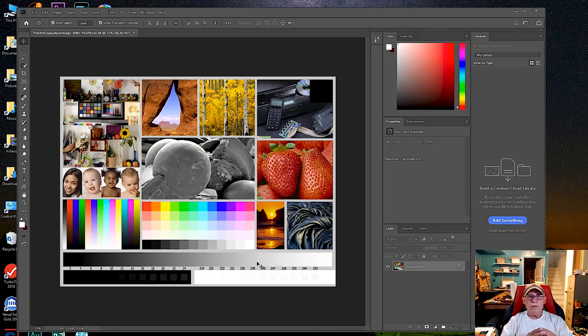So I showed you the Epson 1400, P800, Canon Pro 100, and Pro 1000. Basically all Canon printers are set the same way, and all Epson printers — with slight differences in wording and location — you're setting them to allow the printer to control color using Standard Epson sRGB. This will take your image, send it to the printer unaltered, and if your monitor is calibrated correctly, the output should match. The standard image was prepared by the ICC — the International Color Consortium — and everything about it is correct.